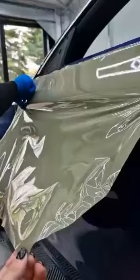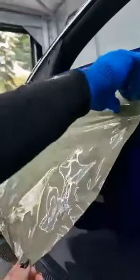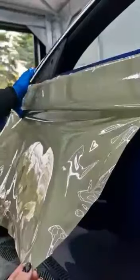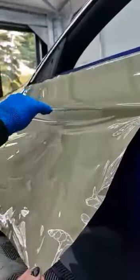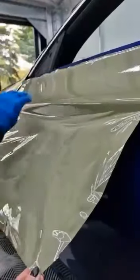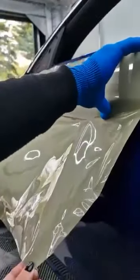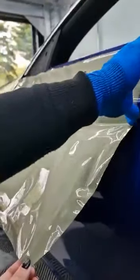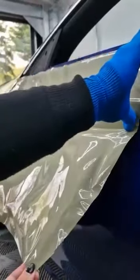Once we feed this into a deep recess, look — every time we go across the recess the film is still going left to right. So when you have a deeper recess, you're not going to end up with those tiny little fingers that you have to heat out and potentially create another glue line. It means we can keep going down the film all the way while it's cool — less chance of glue lines.